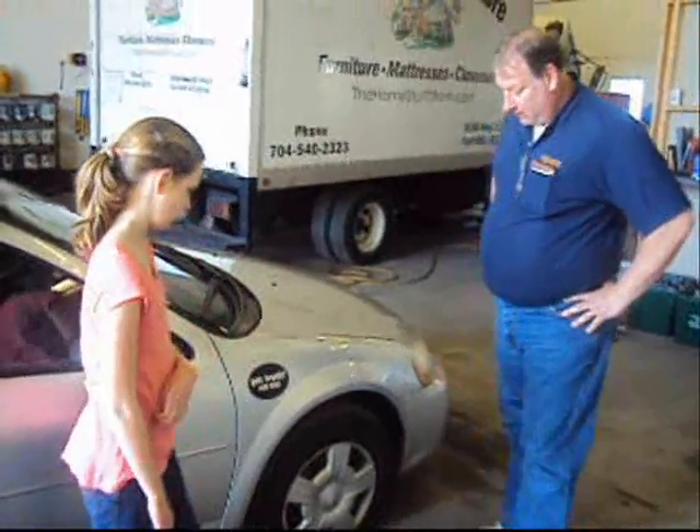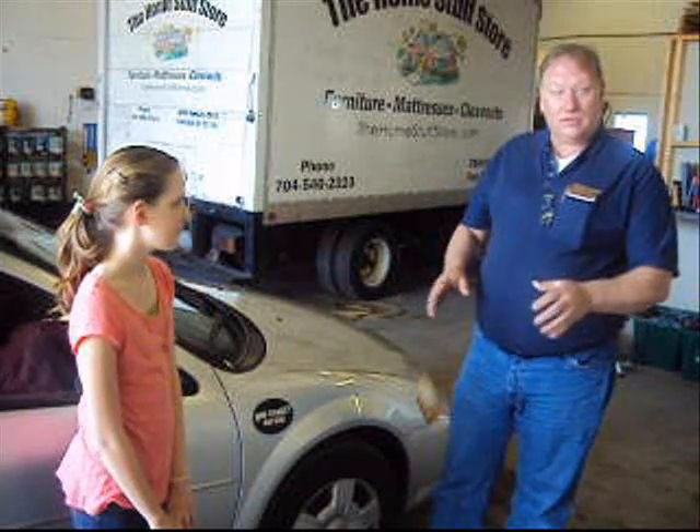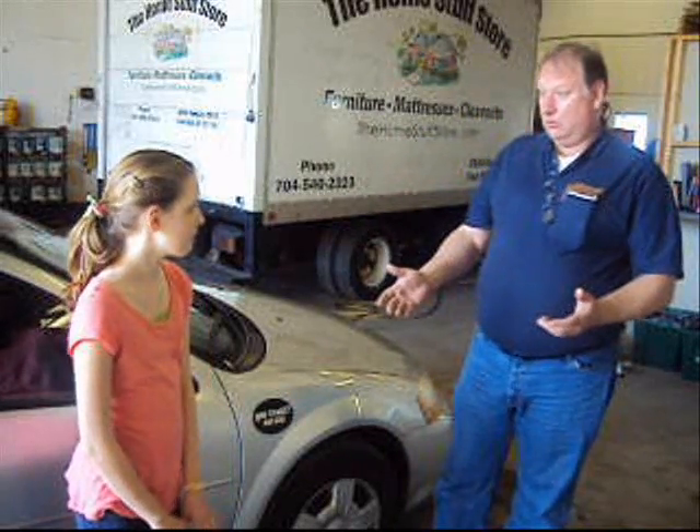Yes. But what would be the first thing you would tell a young driver? Mariah's not old enough to drive, but all of a sudden you notice you've got a flat tire. How important is it that you get pulled over? Well, you've got to make sure you're in a place where, first of all, you can change a tire — a flat level surface. You don't want to be on a hill or an incline where the jack can slip out. You want to make sure you're off the road, because most accidents happen when someone comes by and clips the car while you're working on it. That's how people get hurt.